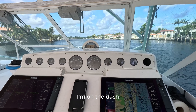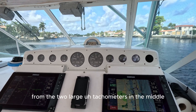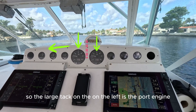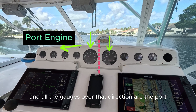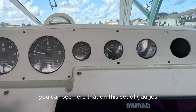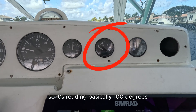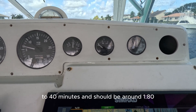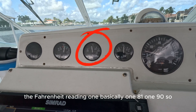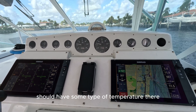You can see here on the dash, I'm driving with the autopilot engaged. From the two large tachometers in the middle going port and starboard is the set of gauges for each engine. The large tach on the left is the port engine. On this set of gauges I don't have any thermostat reading — it's showing basically 100 degrees, but the boat has been running 30 to 40 minutes and should be around 180. You can see the gauges on the other side are reading 180 to 190 Fahrenheit, so we definitely should have a temperature reading but we're not getting anything.